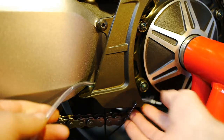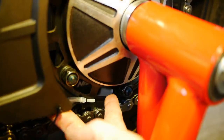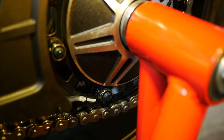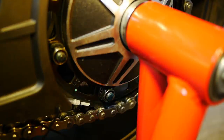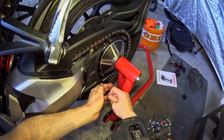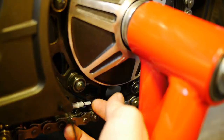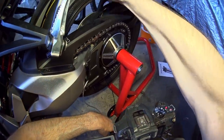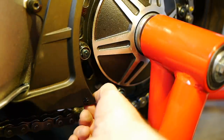Pull this hose through those cable ties till we get it in roughly the right position. Ideally we want the feed tube just in the crook of the step on the sprocket. The problem is the bolts are actually really far outwards, so if I have it there the bolts are going to keep catching on the feed tube. So we actually need to pull it through a little bit further, just positioned so it's lightly touching the flat surface of the sprocket — as the sprocket nuts go by they're not bothering it at all. I'm just about happy with that position, so I can tighten off this cable tie. That is now solidly fixed. Using the wire inside the hose, I can bend it over to give a tiny little bit of resistance on the sprocket. The nuts aren't going to bother it as they spin around.